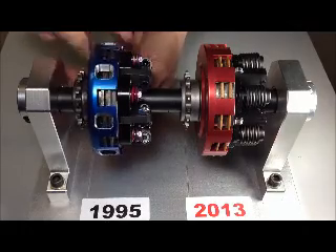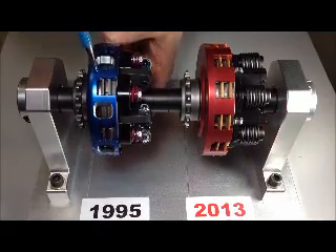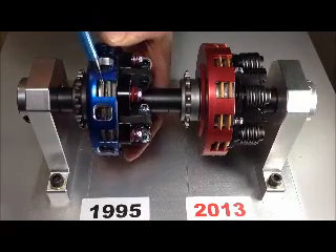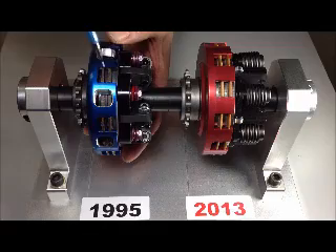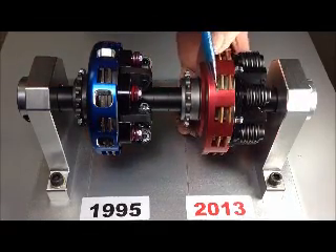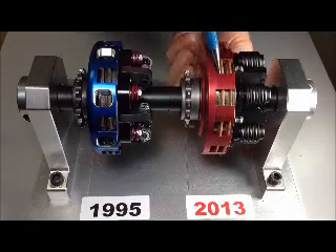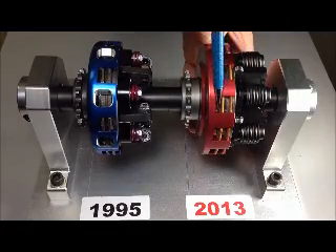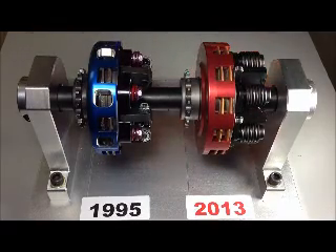Even after the clutch locks up, it will rock back and forth — it will wobble. That wobble wastes quite a bit of energy, and it occurs even after the clutch is locked up, accelerating wear between the tang on the clutch disc and the slot in the drum. The ball bearing, in contrast, has no free play in the axial direction because it's a deep groove type, and it's also a more precise bearing — it does not have that wobble. So we can eliminate much wear and tear, save the cart racer some money, and have a little bit more energy available for acceleration.